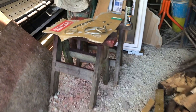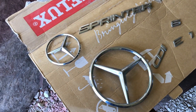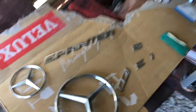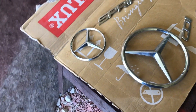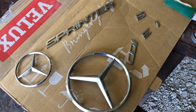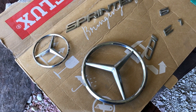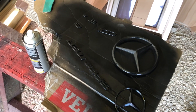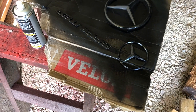I've got all the badges off and given them a right good roughing off with some sandpaper because I'm going to spray them with black bed liner spray paint. You've got to rough them up because they're chrome — if you don't it'll just flake straight off. So I've used some really rough sandpaper and taken the shine right off them. They still look a bit shiny but they're nothing like they were. We've all had a coat now, we'll wait for that to dry, give them another couple of coats and then get them put back on the van.